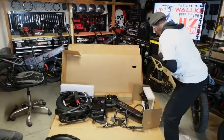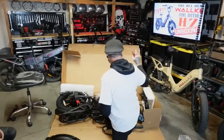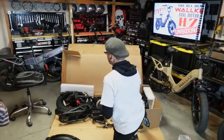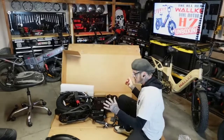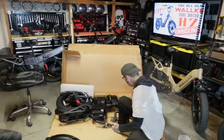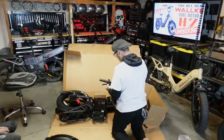You've got this fold mechanism right in the way of your crank, which limits how large a chain ring you can put on there. That's why I've got what I want to say is a 58-tooth — I'd have liked to go 60 but you can't because of that handle. The wiring harness runs through the frame as opposed to under the belly of the bike, so the first time you go to fold it those cables inside are like tight tendons. I loosened it up so I can fold it — and it's 52 tooth actually.